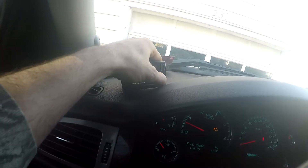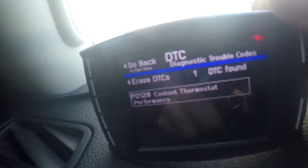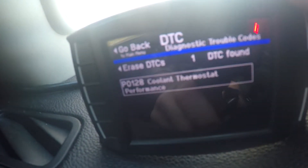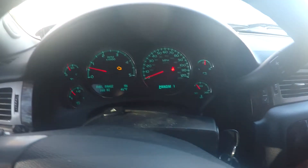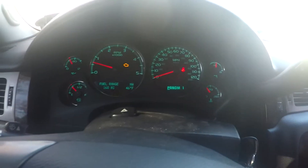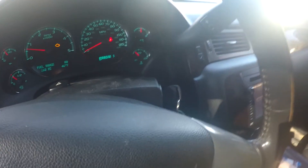I'll just use this scan tool while it's here. And there we go — P0128. It's basically coolant below thermostat threshold. Kind of a common code in these. I figured that's what it was. It had this code pop up in spring this year, but because of the warmer weather it didn't reset — it actually had cleared itself.